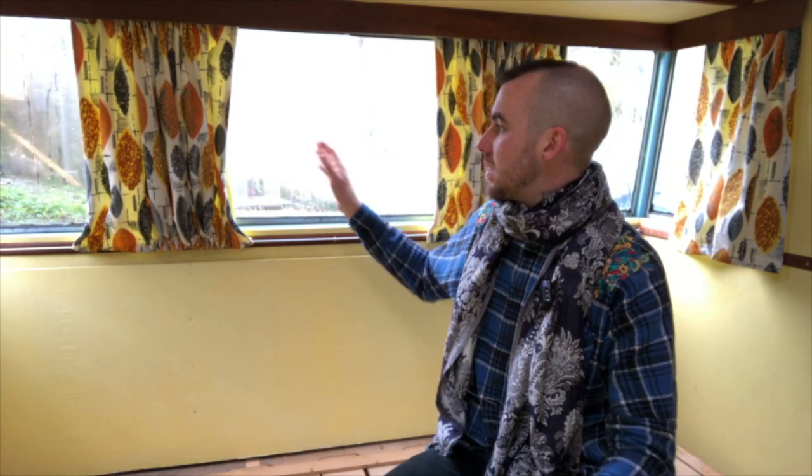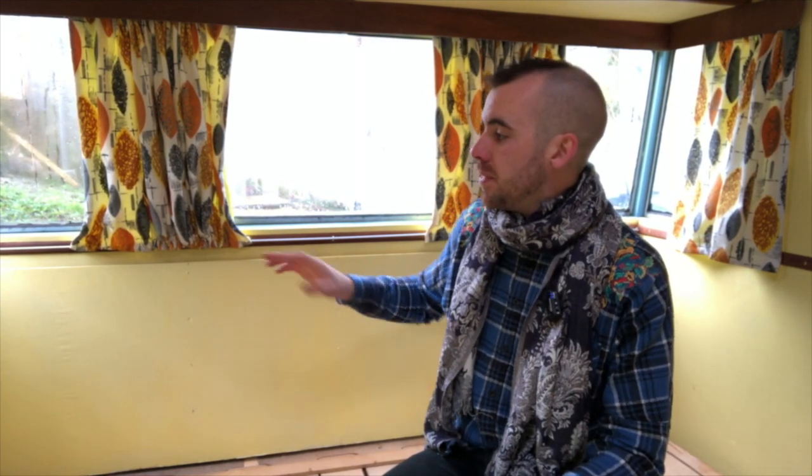On caravans, especially ones with glass windows like these, condensation is attracted to the glass. Even with no heat inside the caravan, the natural temperature difference between interior and exterior — even in winter — still causes condensation. There's plenty of condensation on this caravan this morning with no heat on at all. The problem is it runs down the windows, and if the window is on an angle like the rear ones, it will drip down onto the upholstery. The upholstery retains water significantly longer than glass or wood. Most of the time it runs onto the wooden walls and evaporates quickly, but the upholstery holds it.